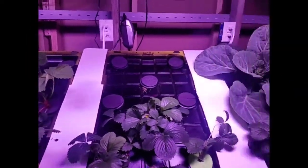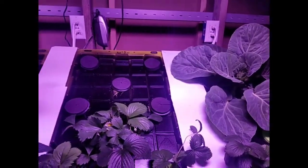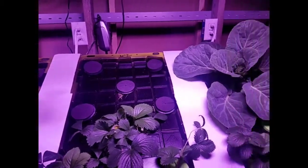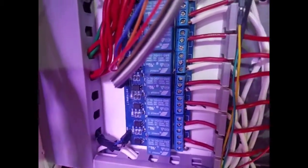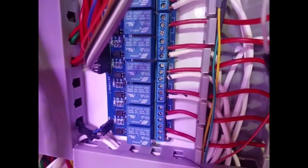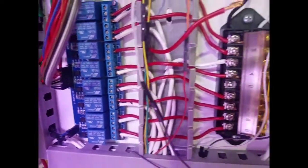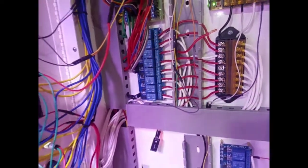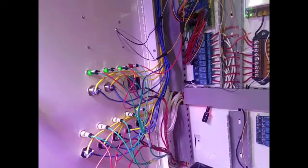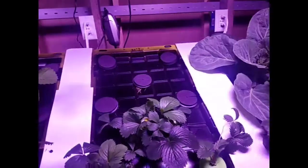This morning I came down and I was a little disappointed — one of the relays isn't working. It just happens to be the one for the pump. This third relay down here — you can see there's no white wire there — because I've just hardwired it right into the 12 volt, so it's on all the time now. But there is a pressure switch, so it does shut off once it hits about 85 to 90 PSI.